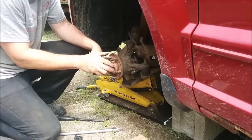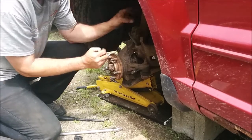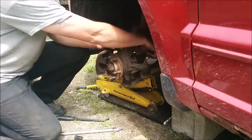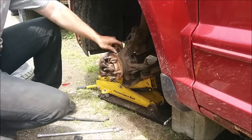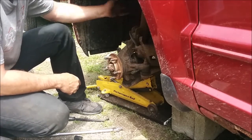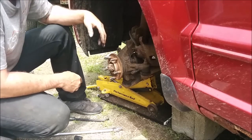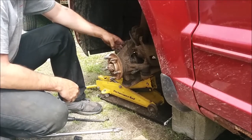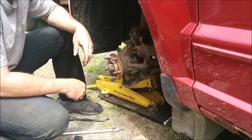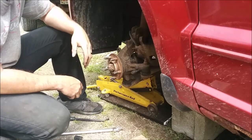Before I put the new rotor on, I'm going to clean this surface. I've already checked the wheel bearing — the wheel bearing is good. The axle is good. Inner tie rod is good. Strut is good. I'm going to have to change this outer tie rod, so I'm going to spray this bolt and this nut back here with some penetrating oil and let it sit until I get the part — hopefully that'll make it a little easier to change. I've also checked the brake lines — brake lines all seem good, there's no cracks. That'll pass inspection. The shock's not leaking. The strut is not leaking, it's not rusted, so that'll pass inspection. This axle — the band on it that holds the rubber boot on has actually still got its gold anodizing, which means that axle has been changed not too long ago. Rubber boots are good, they're not cracked, there's no slop in the axle at all. So there has been some maintenance done to this vehicle, just not a whole hell of a lot.